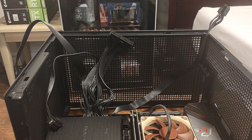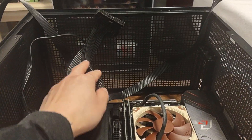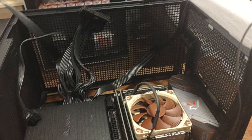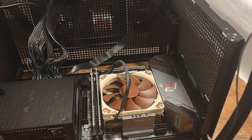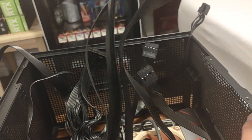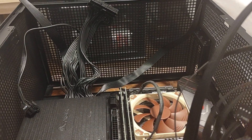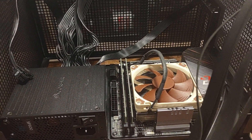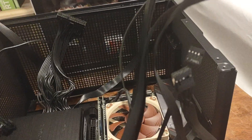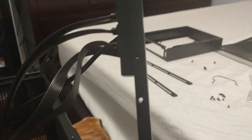For the sake of this video I'm going to keep it short and sweet. I'm going to plug in the power supply and CPU power cables, install the fans, and then put in the graphics card. You always want to plug in all the front panel cables, USB 3.0, etc., onto the motherboard before you install the graphics card — once it's in, everything is tight and you can't get your fingers in there. So always install the front panel, power supply cables, then the graphics card.